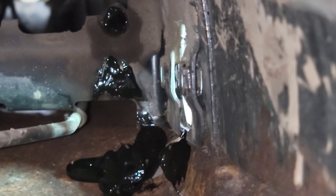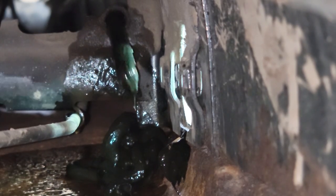The worst offender by far was this clutch cable line that I mentioned. Spraying in the brake cleaner and pushing through the junk. Gross. And then for good measure, I just gave all of the lines a generous blowing out with compressed air. This was actually a really messy process, and in hindsight, I should have done all of this before I even started to sandblast.